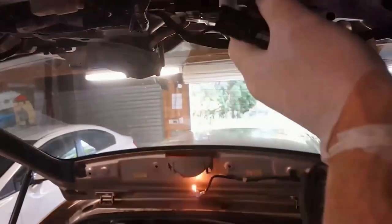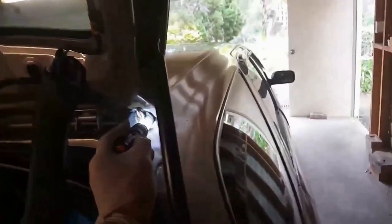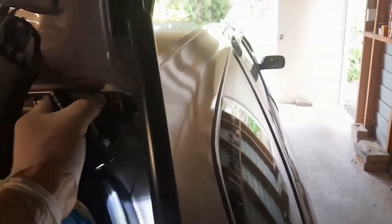That red wire at the back there seems to be the power supply, but I don't think the problem is in this area here. When I open and close the boot, this is so crushed down that I think it's that red wire somewhere. I'll have a look at that a bit closer. I'm getting there — just wiggling this wire harness here. The bulb did go out momentarily, so it's just a matter of finding the right one.